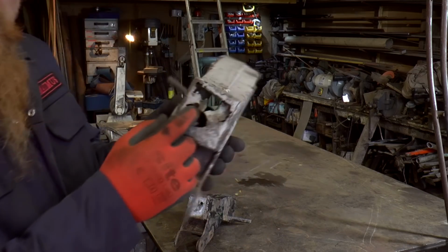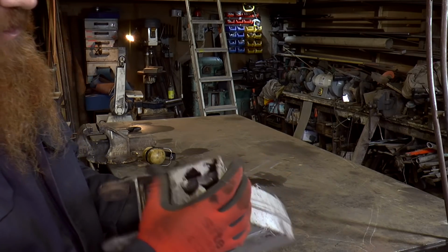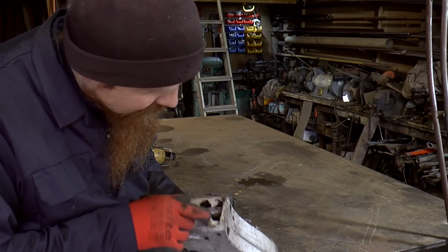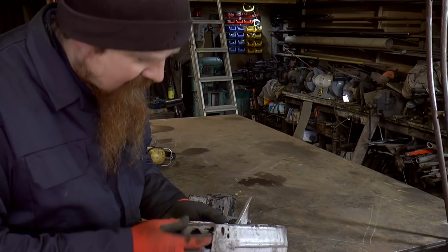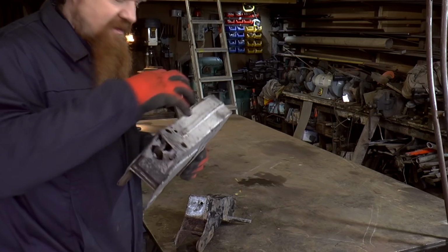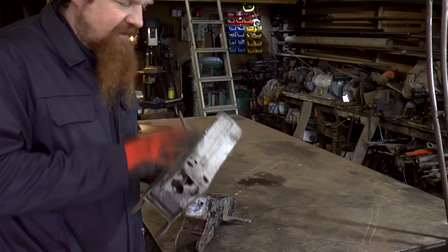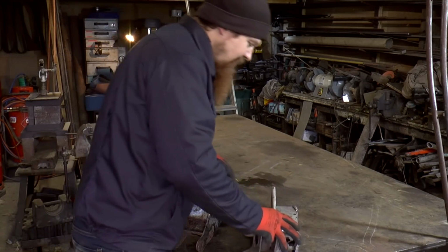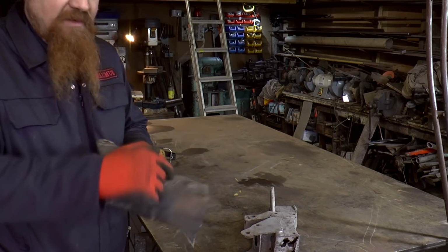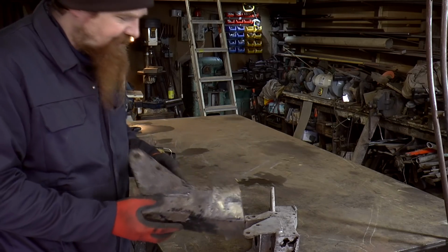And they have these crush tubes inside so that when you do up the bumper bolts it doesn't squeeze this square bit down. They'll probably need something doing to them. Well, actually they don't look too bad. What I'm going to do then is cut some bits off of this one, and then I'm going to use this side, which is relatively undamaged apart from some corrosion on it, as a pattern to rebuild this side, which is where it's actually been, well, almost broken in two and then rebuilt again.